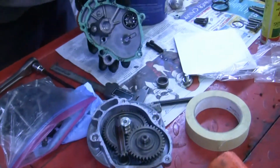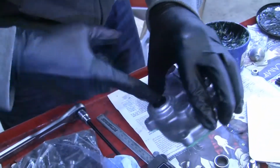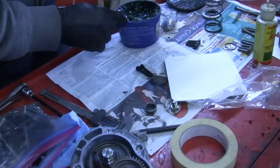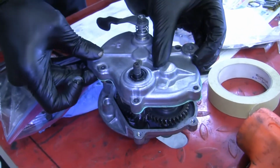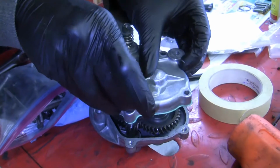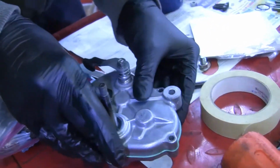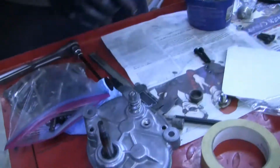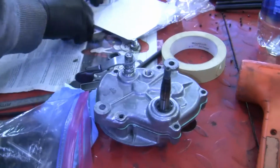We'll put a little bit of grease on the inside of the seal here. I just always kind of generally like to put oil or grease in the seals so that they slide together a little bit easier and they get lubricated when they start rotating. And just be gentle. It should just fall down on here very easily. If you clean everything off, it makes everything a lot easier to work on, then just simply put your bolts